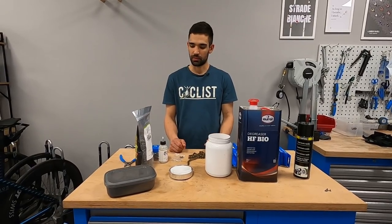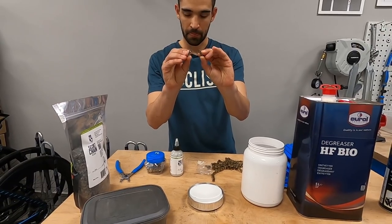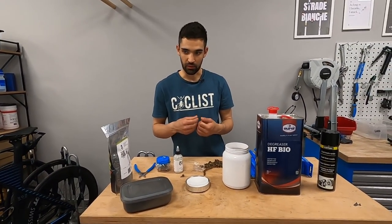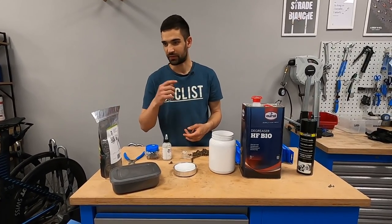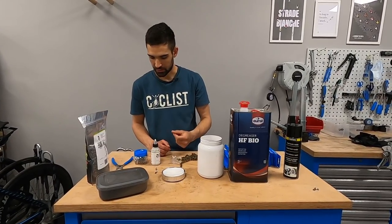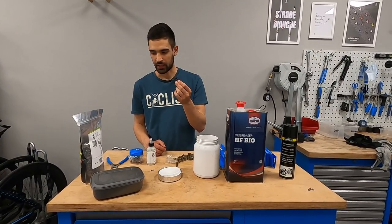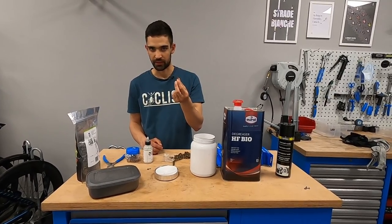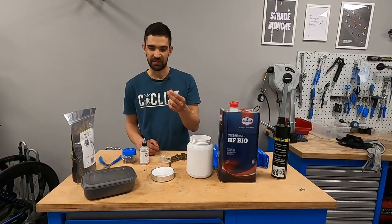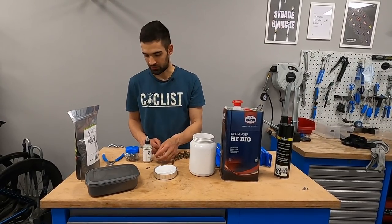If you're done with that, there are a couple of other things you need to know. It's very practical for chain waxing to use quick links on your chain - basically it's the only feasible way to wax your chains, because removing them and pressing them with a rivet all the time is not good for the chain. Eventually you'll run out of places to rivet because chains can last extremely long. So with the master link you just remove that. Regarding reusability - every manufacturer will tell you it's a single-use item, but from my experience they can be safely reused around 10 to 15 times depending on which type. However, for an important event I would definitely go with a new one, because if you try to shift under power a really worn out quick link can dislodge, which will break your chain and your race - and possibly your face if this happens during a sprint.